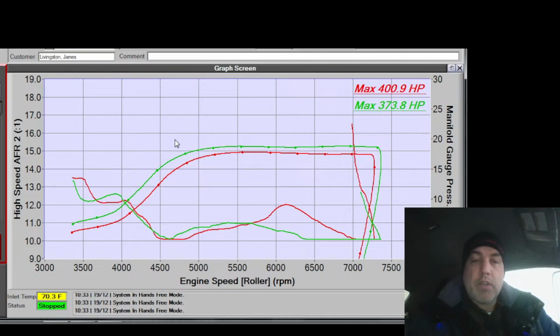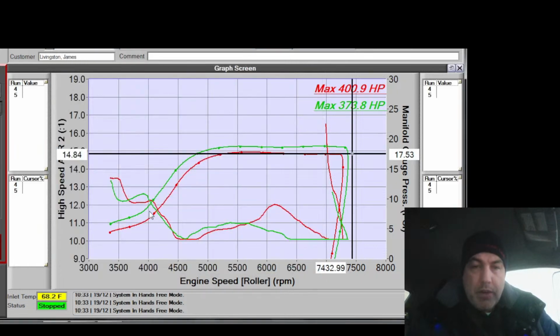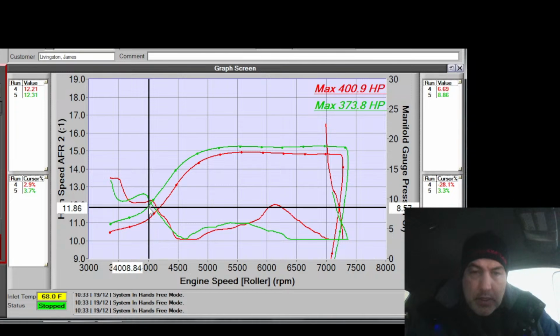So I give it throttle to 100%, and it immediately goes to 3 pounds of boost. Yeah, I mean, the graph on the dyno shows that. And it goes to 3 pounds. The pull starts at 4,000. The dyno says, what is that, 7.5? Let's look at that graph here. So, let's put a cursor on here, close control panel. So we'll be right at 4,000. At 4,000, we're showing 8.57. And we're 13.9 usually. We might be 13.5 today, somewhere in that range.